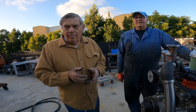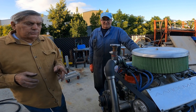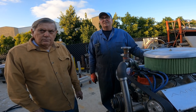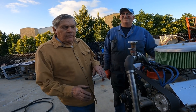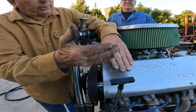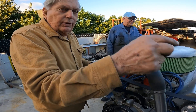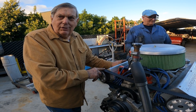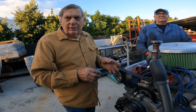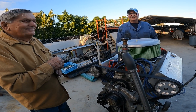Can you overcome that with a standard pushrod? Modern motors use finger followers now - they can get ratio to it. But you need to have the exact perfect cam design, and most cam grinders aren't too good at making a high lift cam like that. If you imagine a rocker arm here and the cam coming around on this side, the cam hits the low side of the rocker. On the other side, the cam hits the high side. So this is a variable ratio - that ratio is different than the other side. So you have two cylinders firing at one particular ratio and a cylinder firing over here at a different ratio. That means you have to make two masters to do this right, and masters are about two grand apiece. We were actually going to do a motor where we tried turning one cam one direction and the other the other direction to get the lobe profile the same, so the cam acts on both rockers the same way.